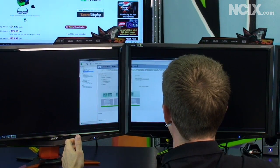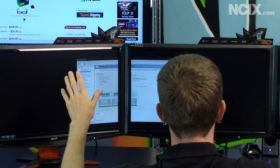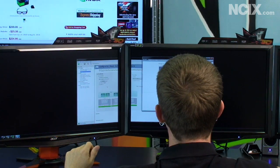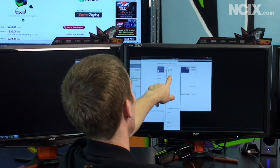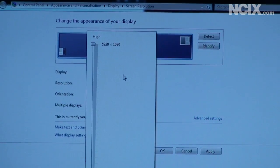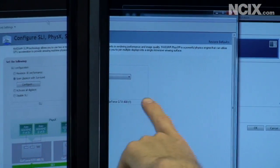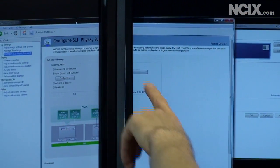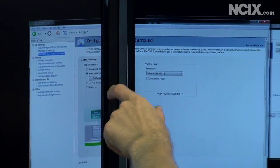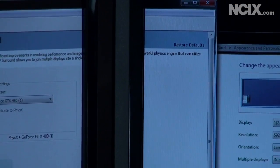Here's an example. By default it leaves the desktop at native resolution, but as soon as I change the resolution to the one we created — we had 5760 by 1080 as our native res, and if I increase it to the gaming resolution and click Apply — that window spanning the two monitors is actually hiding text behind the bezel. The word 'surround' is completely hidden by the bezel. So this gives you a more continuous look for gaming, but it's not ideal for desktop use.